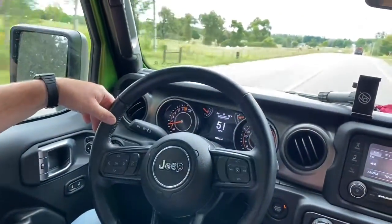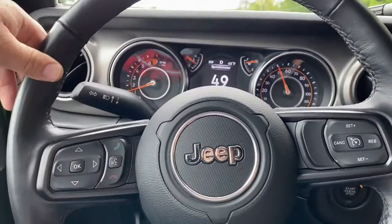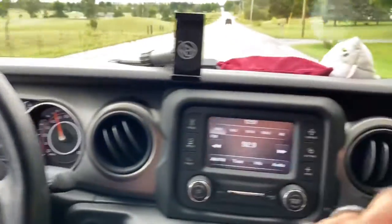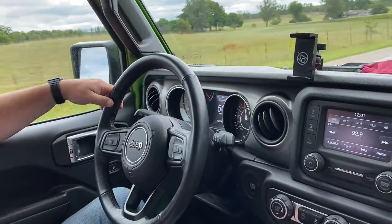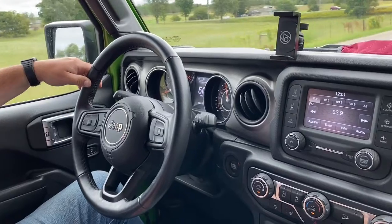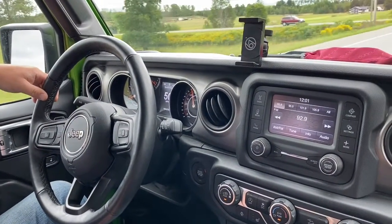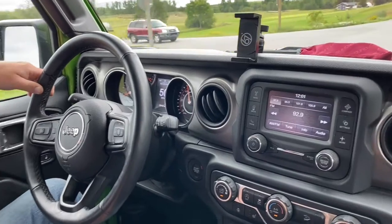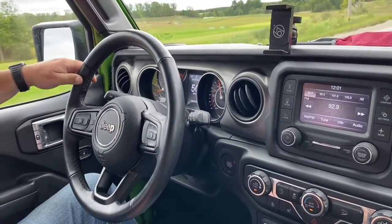So I'm gonna put this out here. I don't know if you can tell or not, but the steering wheel is slightly to the left as he's driving. So we'll get that back in the garage, see if we can make that adjustment in the drag link, and that'll be it for today. It's as good as it's gonna get without throwing a bunch more money at it. Maybe that's the Jeep thing.